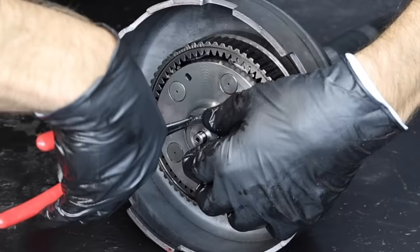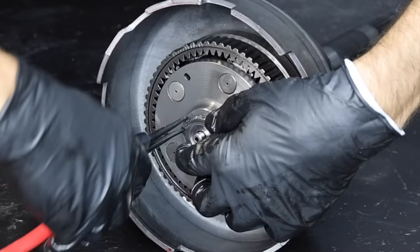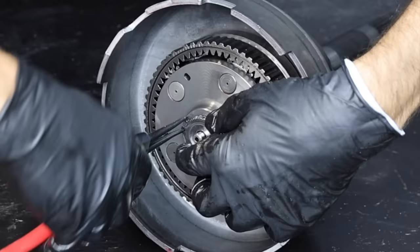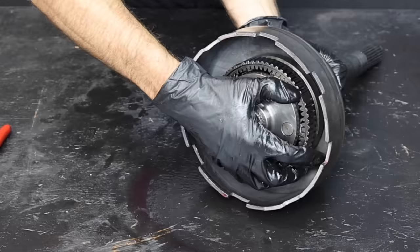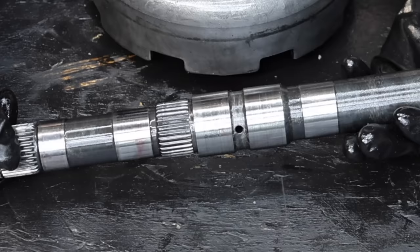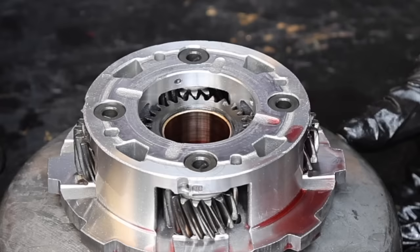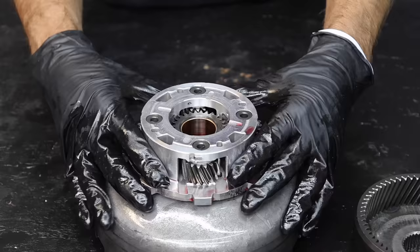It's pretty critical to make sure all the clutches are fully seated — there should be a very small gap. Let's move on to the intermediate shaft and replace the thrust washers. We have to first remove the snap ring to remove the planetary assembly. Let's go ahead and inspect the faces of the contact points on the intermediate shaft — all the contact points look good with no visible aluminum transfer or damage. Let's remove the ring gear from the top of the assembly — everything looks good with this assembly.